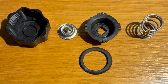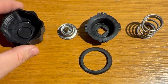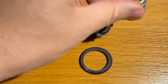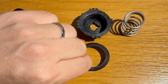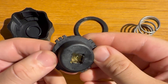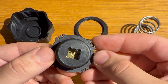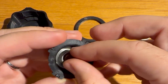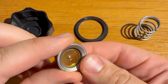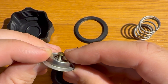This is the inside of a PCD-100-160 XP cap. We have the cap body, the valve, the insert that holds the valve, the spring that applies pressure to the back of the valve to stop the cap opening until the set pressure is reached, and the seal. Take the coolant cap off any MG Rover vehicle — one of the black coolant caps — and you'll see a brass valve through a small aperture. But if we turn this over, we find that the brass part is actually an insert in a larger valve assembly.